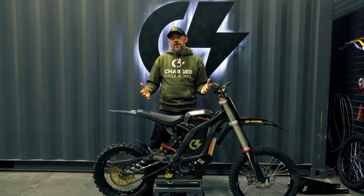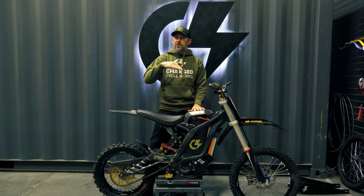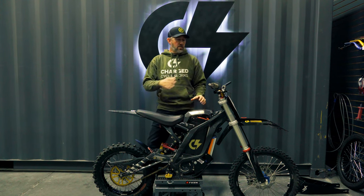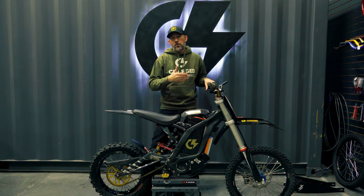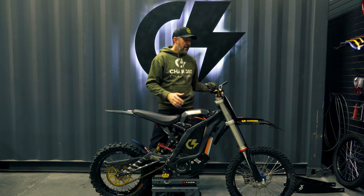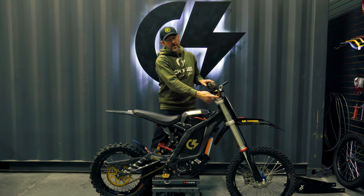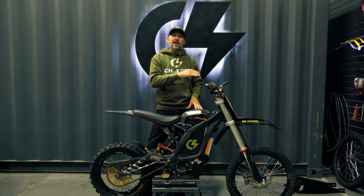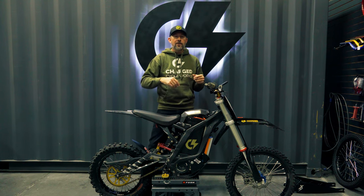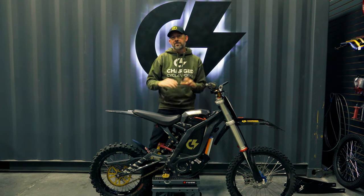Goal number three — I've already talked about this a little bit — it's the geometry and handling of the bike. The front end is tall because of this long fork, and we've got to raise the rear end up. So why couldn't I run a 21-inch wheel with this big KTM fork? The problem is I had to raise the forks up until they hit the handlebars to lower the front end. When I did that, I lost the clearance needed for suspension travel with a 21-inch. If I ran a 21-inch up front right now and hit a big jump, the tire would probably contact the triple clamp and I'd go end over the handlebars — I don't want that.